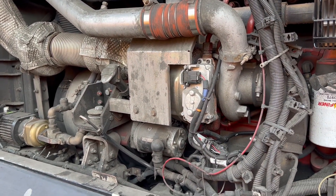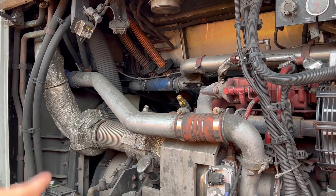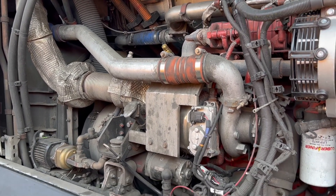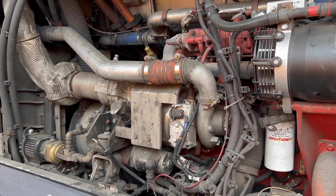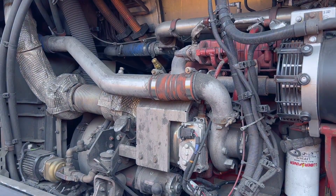The last three pumps that are not accessible on this bus are the power steering, the air compressor, and the water pump. All three pumps should be properly mounted and secured, and the belt should have no more than three-quarter of an inch of play at the center of the belt. The belt should not be cracked or frayed. That completes my engine compartment pumps.